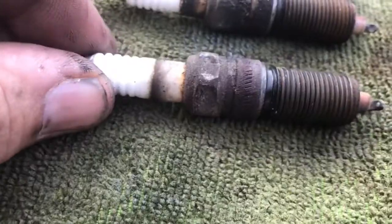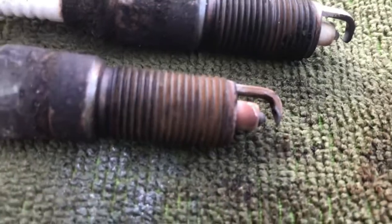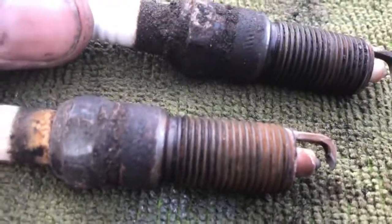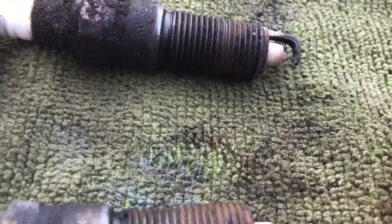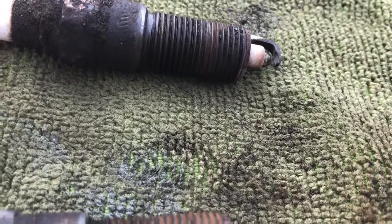It started getting worse. So I guess what happened, I put the coil on it, had a little better spark in it. I'm assuming it burnt its electrodes up. It ran good for a couple of days, and it started misfiring again. It was actually popping out the exhaust. And it was wild. It was really running bad. And look at that. That's amazing.